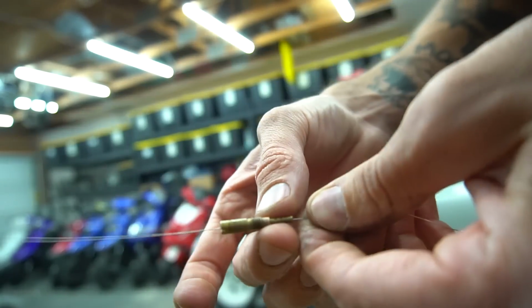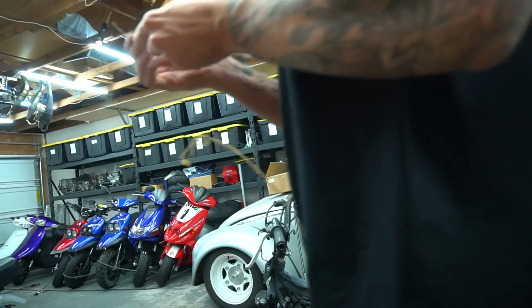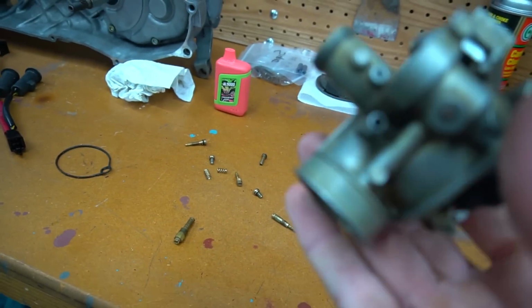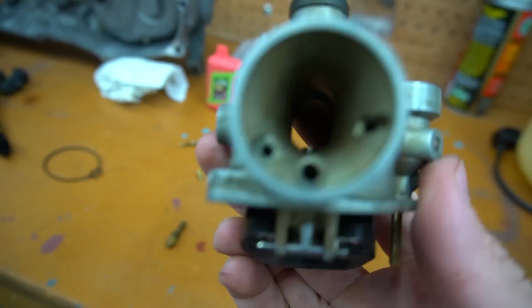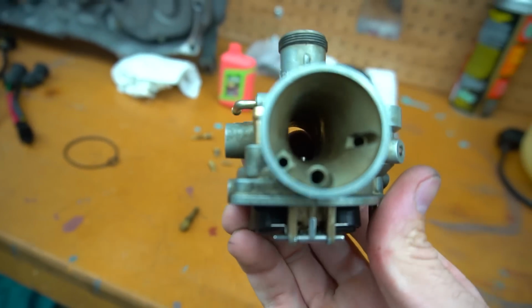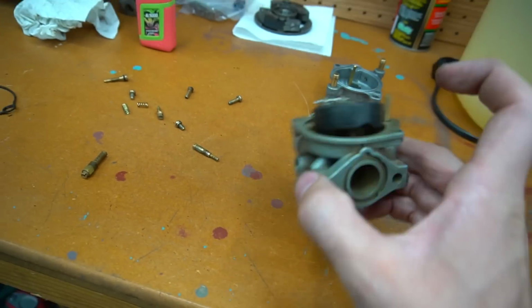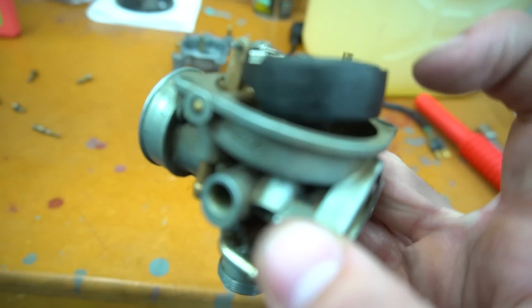And then I remembered I have this set of guitar strings that's perfect for this type of stuff. So just got this one cleared out. Finally, dude, it took forever on this thing. It still can use some more cleaning. Dude, this thing is bad. Alright, spent a minute cleaning everything, and this is all I got. I can clean it a little bit better, but for now, I want to hear this thing run. Look at the actual float bowl now. But float is now working and floaty.